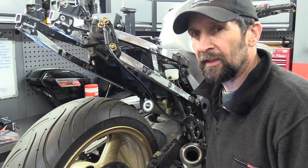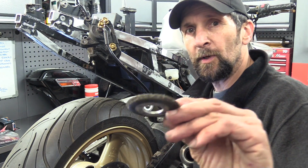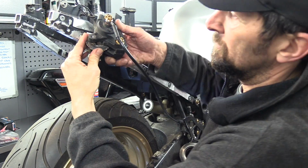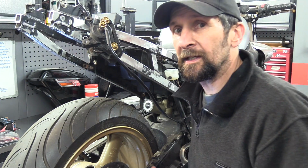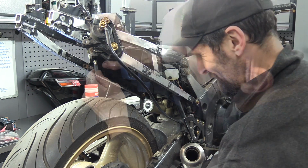Now obviously, there's no disc in between the pads, so use your common sense. I'm just going to use a little bit of an old cutting disc, slip it in between the pads to represent the disc and stop them popping out and then mess everywhere and start over again.